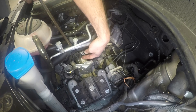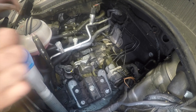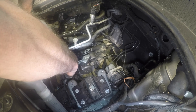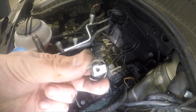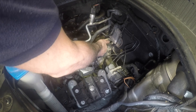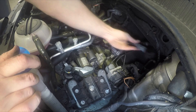With the three bolts removed we can pop off the first gear linkage cable — this is done by levering it off with a screwdriver. The second linkage is under the aircon pipes and coolant hoses; there's a metal clip that slides over the top and keeps the cable in place. The clip lifts up in the centre and slides off. With that removed we can move the whole gear selector cables to the back and push them out of the way.